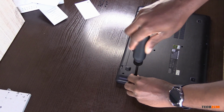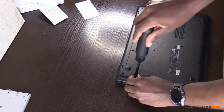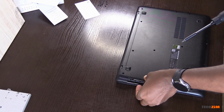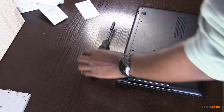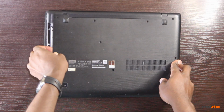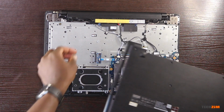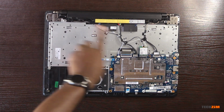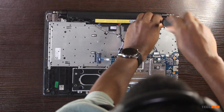13 screws later, the job is done and the magnetic tips are a plus. They make it easier to pull out these screws from these little wells they're in. On this Lenovo, remember to remove the disk drive before removing the bottom cover, because there are hidden screws for the back cover that are obscured by the disk drive. They also made it look like it has a removable external battery, but it's not. To remove this battery, you need to open it up and remove these screws to free it from the motherboard. Seems a bit unnecessary, doesn't it?